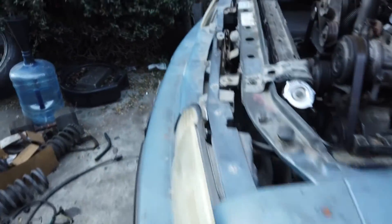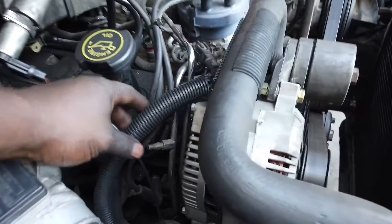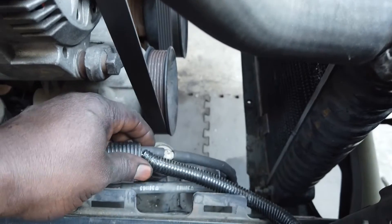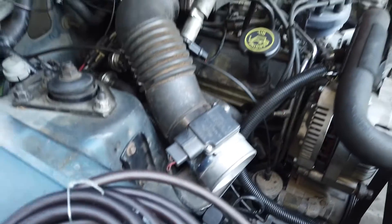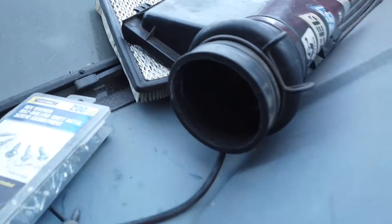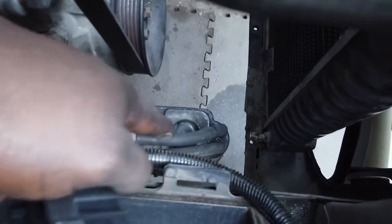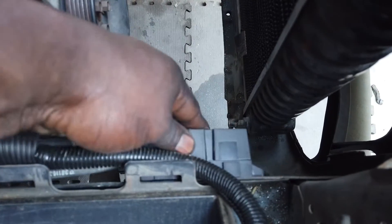I put the clutch cable in and I got my wire from Amazon to do the 3G hookup. Here's the loom I used for the alternator connection right here, and I connected it right here. I got these terminals from Amazon with small eyelets so I could drill them to the size I want rather than having them be all loose. I also got this mega fuse holder and I'm going to mount it down here by the evap box, right around that area.